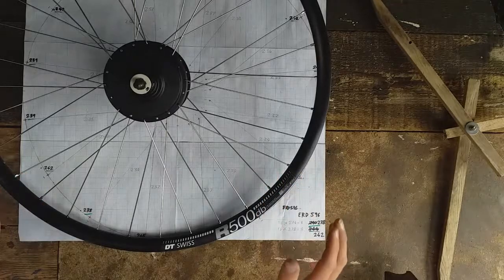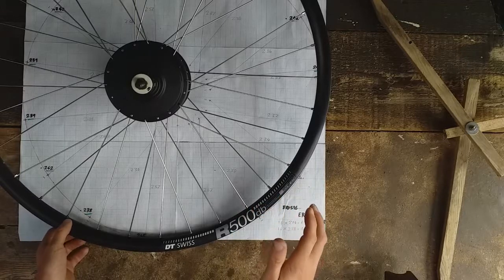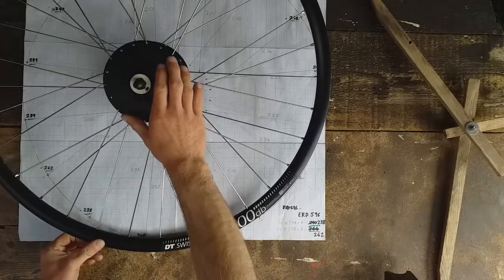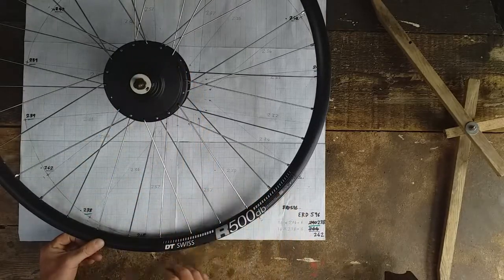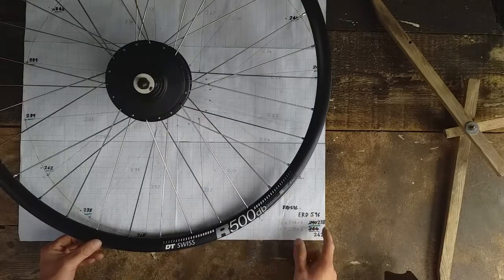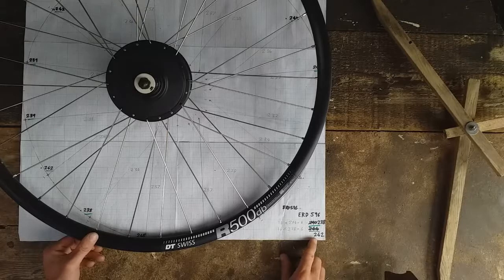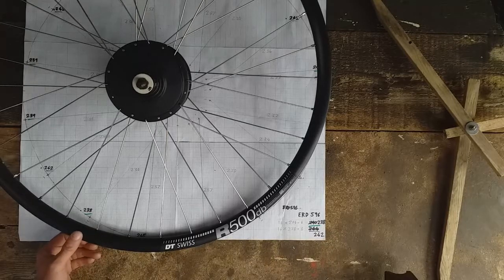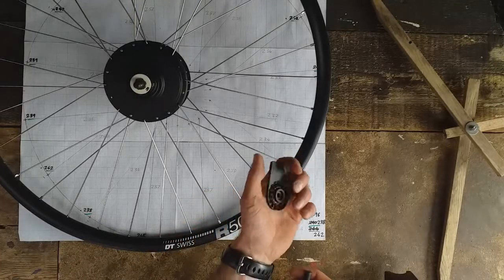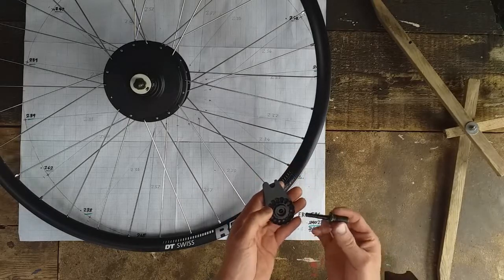That's the wheel now finished. I'm not sure where I went wrong with the measurements, but if I'd used spokes two millimetres shorter this would have been a much easier build. So if you intend to build one like this with this spoke pattern — the 36 hole hub, the 32 hole rim, and assuming the rim has a diameter of 596 — you're going to need 16 spokes that are 238 and 16 that are 242. Next is to fit this to the bike, and for that I'm going to need to remake this no-turn washer to engage with the disc brake, because this particular one doesn't work with these axle adapters. So that's it for this video, thank you for watching.